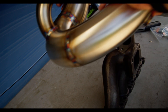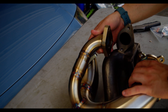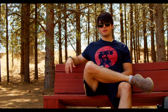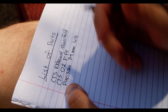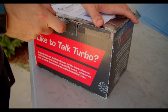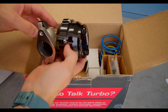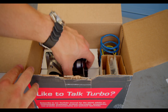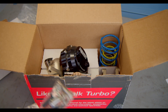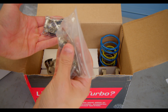Although GTIs and TTs are both Mark IV cars, they share the same downpipe tunnel. And what this pipe does is place the downpipe exactly there — it's actually built to work bolt-on with their exhaust manifold, and includes provisioning for an external wastegate, specifically a 39mm one. There's nothing inherently wrong with internally wastegated turbos, but since the manifold and the O2 pipe are built to work together, we might as well get the third piece of that puzzle that we know will fit. This is a 39mm wastegate from Precision. Not only does it look cool, but it comes with a whole range of springs to allow us to change how it works. These are adjustable, and it also has a ton of installation hardware and spacers that we can play with.